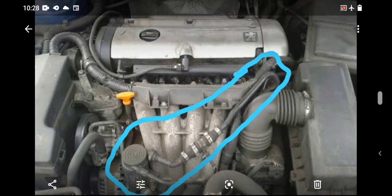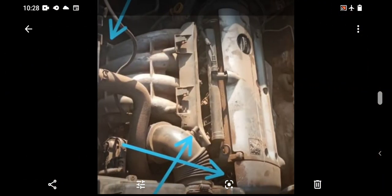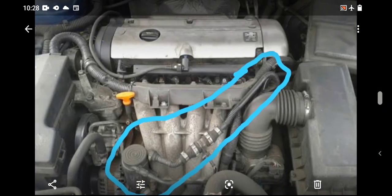Because the most important one is not even the fuel consumption. Some might claim they did it, they don't have that hose, and it's not consuming any fuel. Now, it's not every EW12J4 that had this. The one in this particular case is actually 3FZ. There are some Peugeot 407 with the EW12J4 engine, but their intake manifold is not this aluminum or cast one. Theirs is special plastic, which on the cylinder head will be engraved E4, while this one is engraved E2.